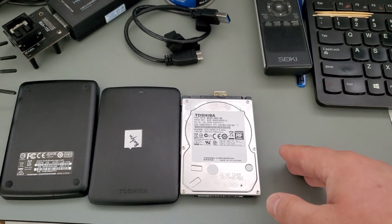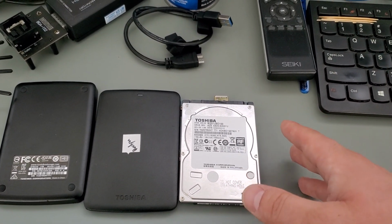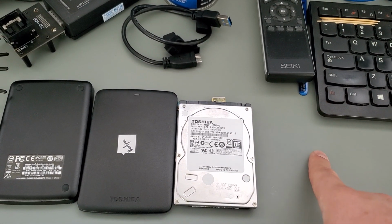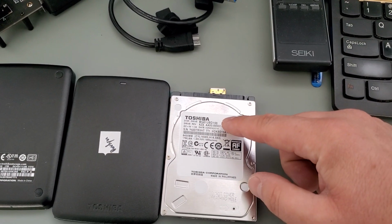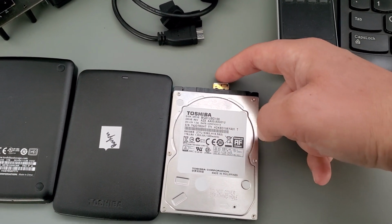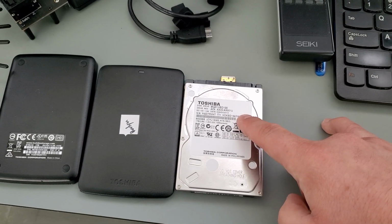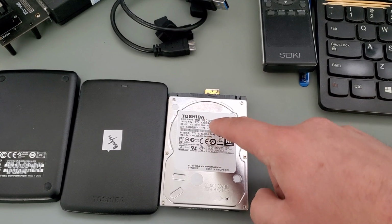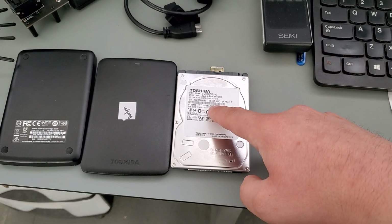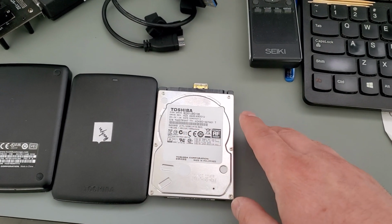So the customer brought it to us, and now we are going to discuss those two different recovery approaches, USB versus SATA. So when you remove the hard drive from the external enclosure, by design, the drive is going to have a USB interface in the electronics. Okay, it's the same with WD products. They all have USB integrated for all of the 2016 and newer models. Okay, Toshiba started back in 2014.